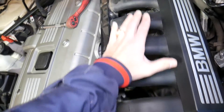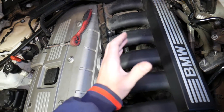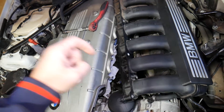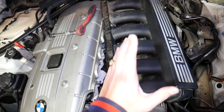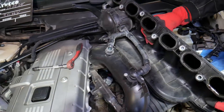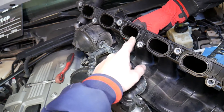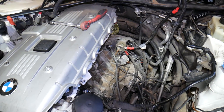Once you've done that, you'll need to locate your intake manifold — it will be attached to your engine cylinder head. That entire intake manifold assembly will need to be removed. We have a full video on the channel showing how to remove and replace the intake manifold, and I'll put the link in the description below. Every time you remove the intake manifold, put new gaskets in so you don't have to do the job again — they're not expensive and skipping them can cause problems later.